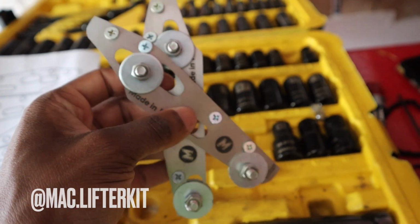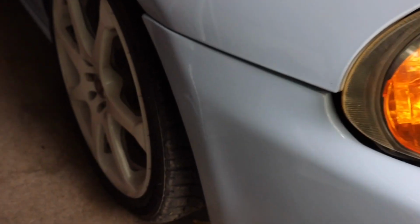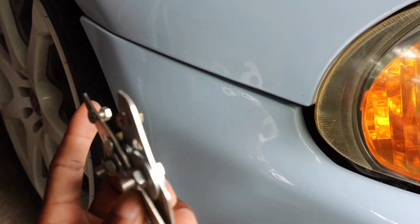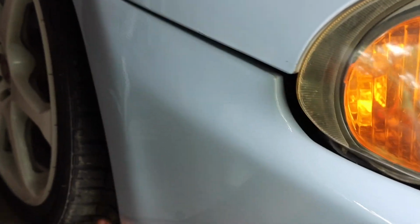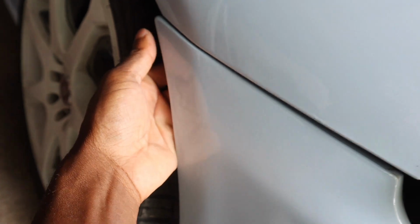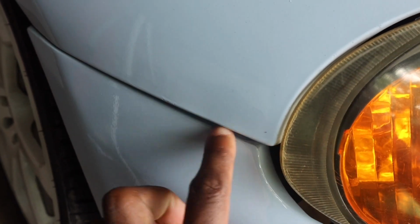They make these new little tappers or whatever you want to call them to screw into the bumper. Now, if you guys can see right here, we have this weird little gap, or just some sag. And I'm sure every old Honda has this bumper sag in some way, shape or form. This is supposed to be tucked up, which is what this does. And this actually has two holes instead of the regular Delsol one that just has one right here and here only, and then nothing there.